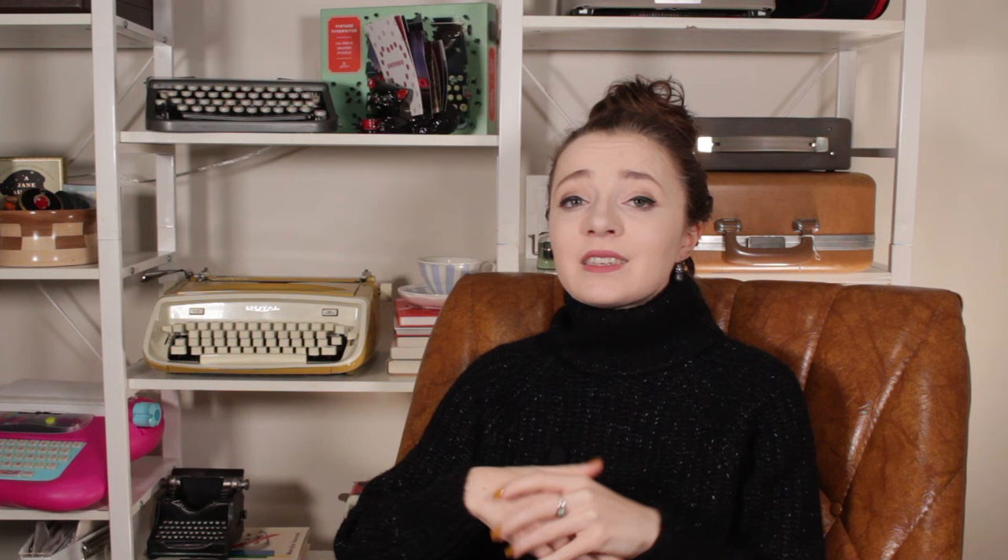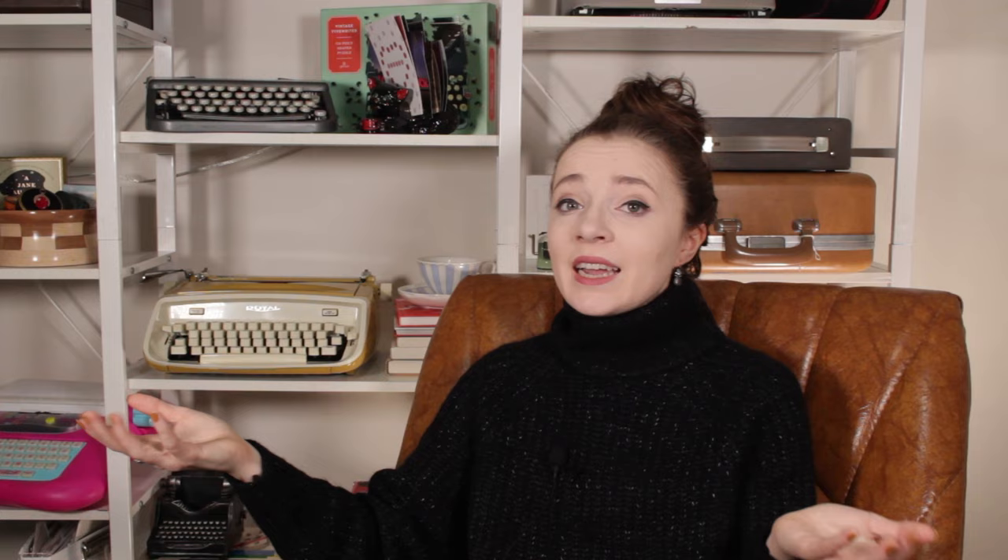We've cleaned the inside, the outside, and the accessory parts — what if your typewriter has a dirty case? Standard machines won't come with cases, but portable typewriters probably come with one. Cases can get dirty and really smelly because they have fabric inserts or softer materials that attract musty smells over time. I set a smelly case out in the sun for a little while to evaporate or bake out that weird smell. People also use lavender sachets or charcoal inside cases to keep out musty smells. If the case is dirty, use a cleaner or soap and water on the outside, then set it in the sun to dry. You don't want the inside of the case to be wet when you put the typewriter in it.